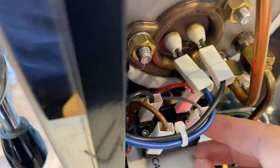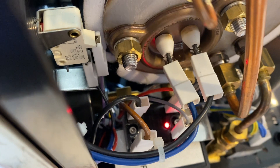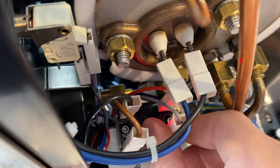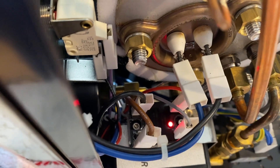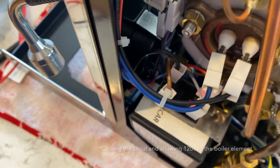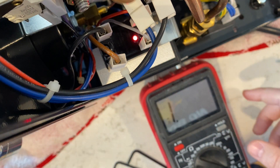You can see there's a little light down here — the PID is calling for heat, saying we've got to turn on, the little relay needs to turn on. It's on. If I pull one of the leads off, you can see that relay turns off. So the relay is supposed to be on right now — I just disconnected one of the leads so we can test whether this is actually sending voltage across. I'll put the phone here and show you where to put the leads so you can test this.